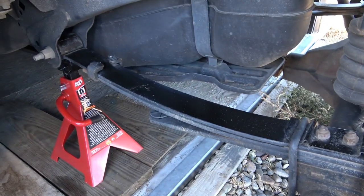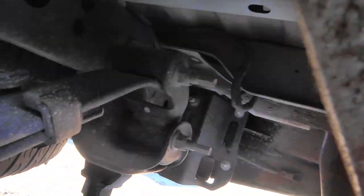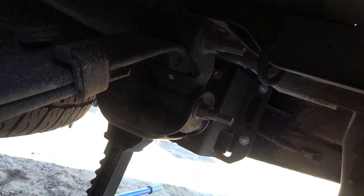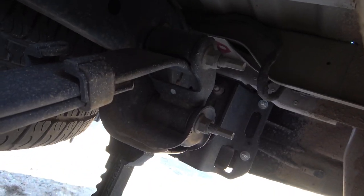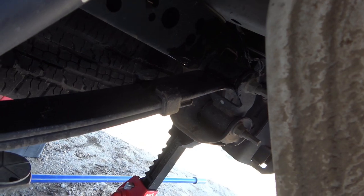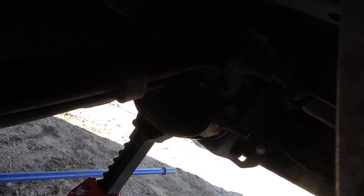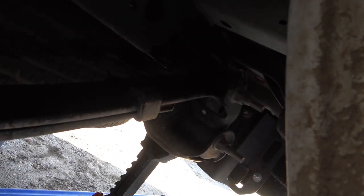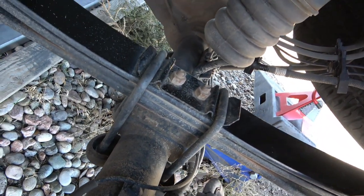That's the hinge — it moves up and down and stretches out because the spring is in an arc right now. When you put a load on here, it flattens out. It's that shackle that allows it to flatten out. It's got a hinge, two bolts, and it does move. As it gets more weight, it actually gets a little bit longer — that's why it has the shackle, to allow it to extend out the back end.